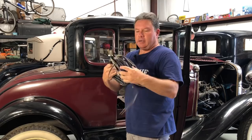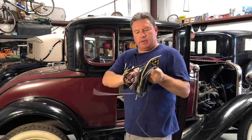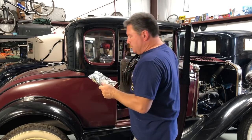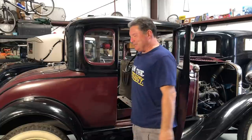So what happens next for this car? The next thing you're going to see is brand new wiring going in, since 97.3% of all the hooptie is now removed from this car. We're going to do it right — it gets a brand new wiring harness. Thank you so much to Steve Becker over at Burt's Model A Center for helping me get the proper harness, because we're installing turn signals with an electronic flasher so we can put LED taillights and they'll still flash at the correct rate regardless of current drain. We're going all-out with new proper wire with the correct color code, from the junction box to the generator — or in this case a 6 volt positive ground alternator — and the correct wiring harness between the dash panel and the junction box. I'm turning this into a two-parter since it just took way too long.